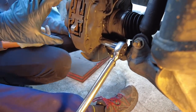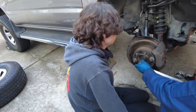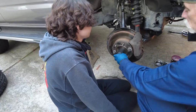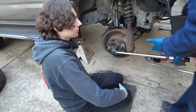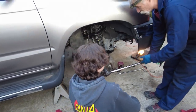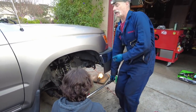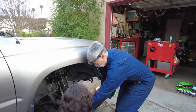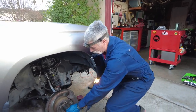We've got both of the caliper bolts torqued to 90 foot-pounds. Here's a good body mechanic tip: when breaking free or tightening lug nuts, you always want to be pushing with your weight — not lifting up because you'll strain your back. Bend the knee and lean into it, putting your weight into it.